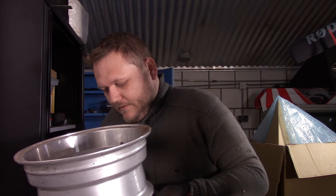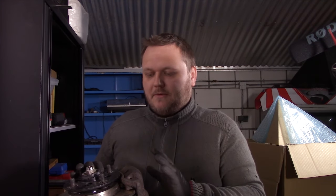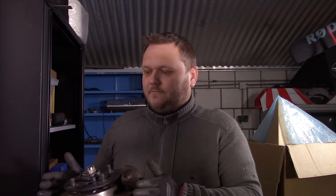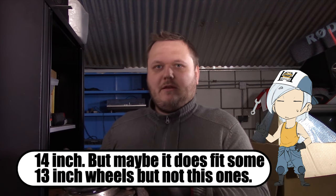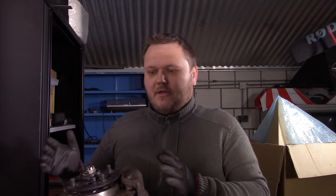It's not by a very big margin, maybe half a centimeter, but it is free. But the same bracket can be used with a little bit larger rotor. But then, of course, you have to go with 13s. And even if you want any bigger, the car this is a donor of came with big Brembos. So it's even possible to install Brembos on it.